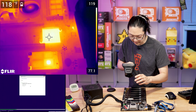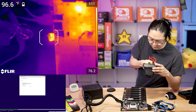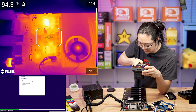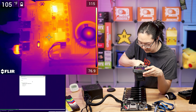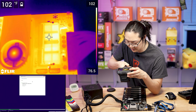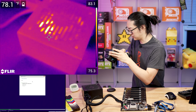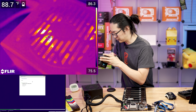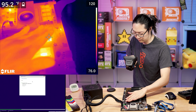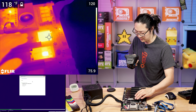Looks like that is the chipset right there — pretty warm. Remember, this has nothing on it right now. There's our USB dongle. Looking over here on the CPU side, this is all the power delivery components. The CPU itself is actually not that hot, relatively speaking. This right here is our RAM. That's our 24-pin cable going into our power supply. So the chipset actually does get pretty hot to the touch — maybe I'll put a better heat sink on that.